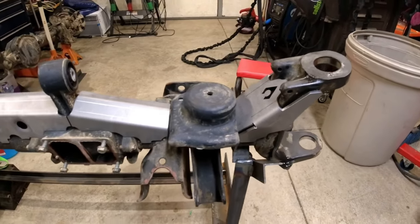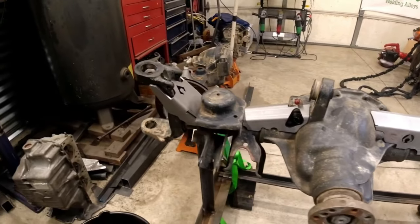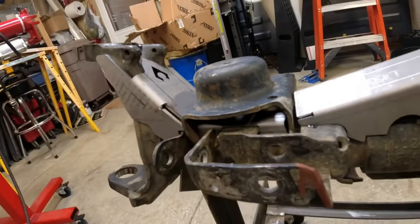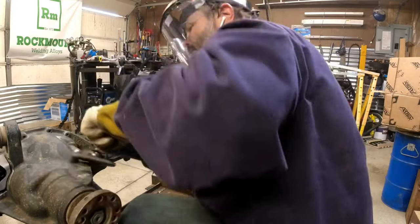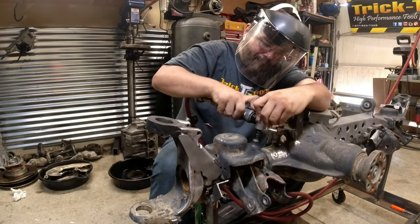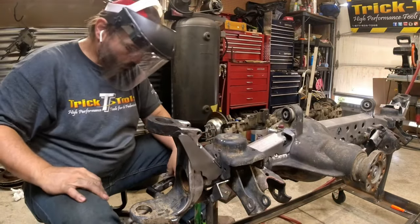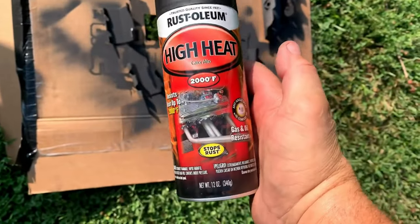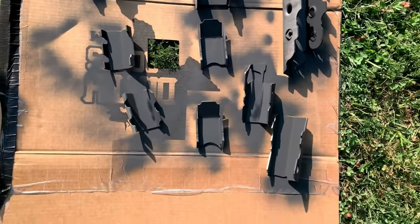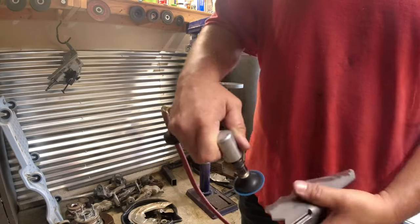Other than the lower C gussets, that's pretty much where it's all going to go. I've got to get it all laid out so I can get it sanded and cleaned. This one's going to be a little tricky — I have no idea yet how I'm going to get this one inside of there. First, you want to work everything down to bright metal whenever you can. We're going to be using the Rock Mount Polaris MIG — it's made for maintenance so if there's a little paint it'll be fine, it's a very strong wire. We'll coat the inside with high-temp Rust-Oleum, which is good for 2000°F, to protect from salt. After it's painted we'll sand the edges we're going to weld and knock off the mill scale on the outside.